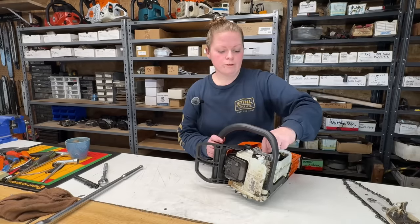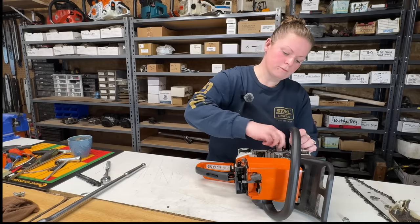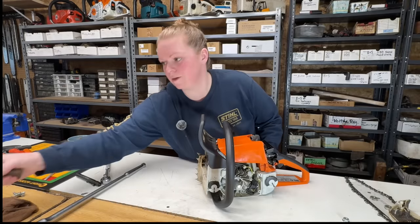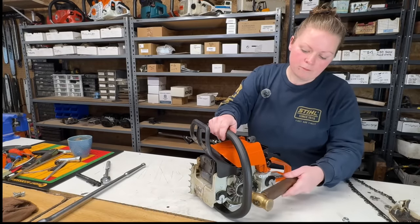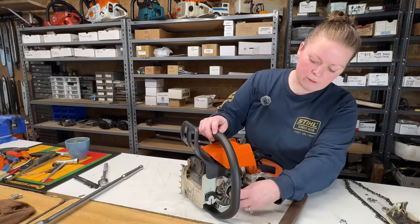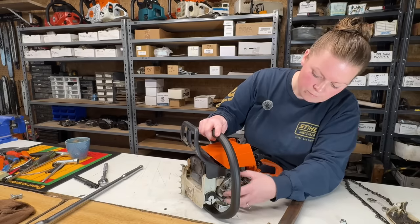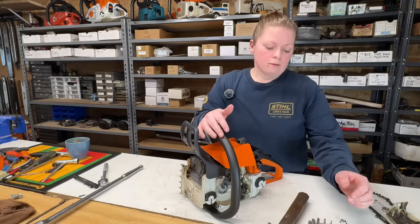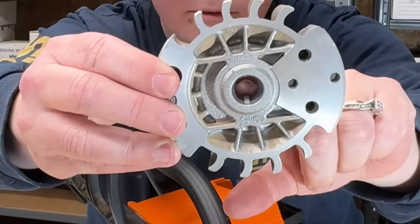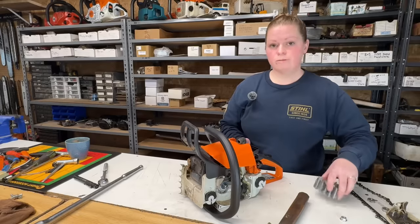With my stopper in place, I'm going to remove my flywheel nut. I've got my flywheel knocker here — screw that down, turn it back a turn, then grab my hammer. Just wiggle it and it's loose. I'll unscrew the knocker and there's the flywheel off. Let's examine it — the flywheel key is right in there. It's perfectly fine, not sheared. This is not the problem, so I'll go ahead and put my flywheel back on.